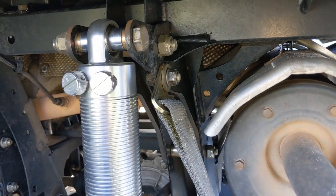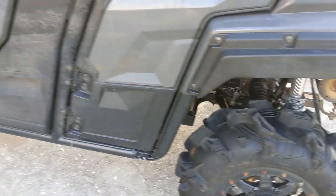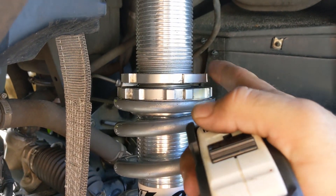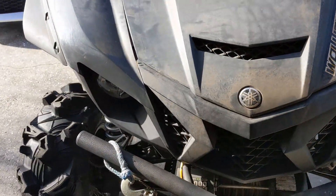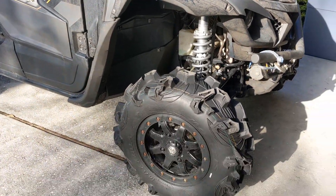I'm using a bracket setup here which gives the shock a little better leverage, so I didn't want to go too crazy stiff at first. I'll probably end up cranking it up another inch. That's really why I wanted aftermarket shocks — just so I could tune the preload better. The front has a little more preload than the rear, just because that's how it worked out to get it level. The front strap setup is not great, it's going to require some work. I just couldn't set up the straps the way they were intended because I would have lost way too much down travel. The point of putting on aftermarket suspension is to improve the ride and the amount of travel, not decrease it.